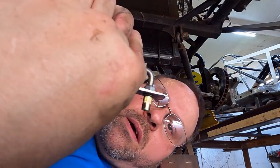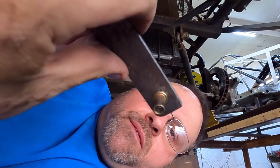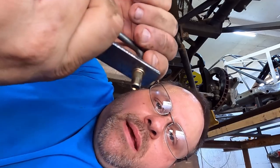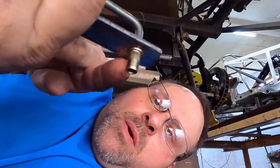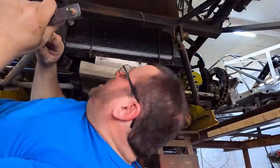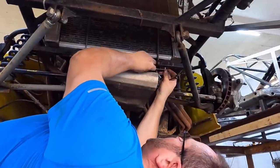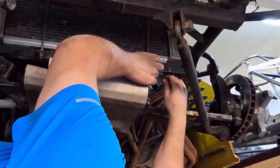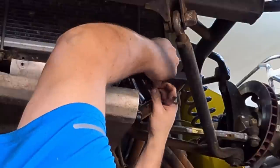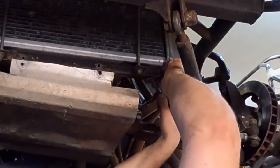Check this out. What we got here: threaded nut insert, 1/4-inch bolt that's been bent, a flat piece of steel with a hole drilled through it, and a nut on top. That lets you spin that nut down without it turning your threaded insert, so you can insert that. It just keeps you from having to buy a tool. I just make these up as I need them and use them. Real handy, but that works just like this right here, because I can just stick it in there and spin her till the cows come home.